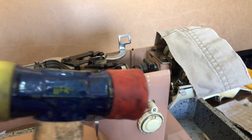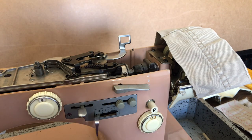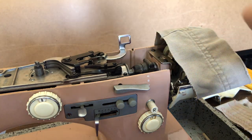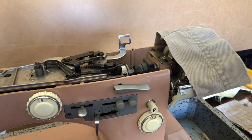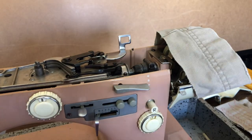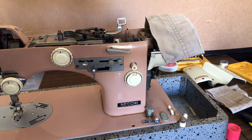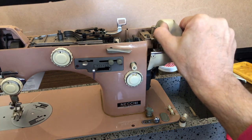You have several options. This is a soft silicone mallet. You can get a rubber mallet, or take a scrap piece of wood — a dowel would work. I have a regular hammer here with a nice rubber end that's much more like a rubber mallet. I'm going to take this rubber end of the hammer and nest it right up behind the wheel. You do not want to hit any other part of the machine — be careful of the bracket where the bobbin winder pushes up.